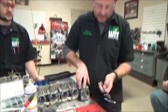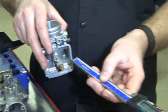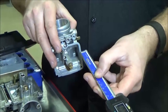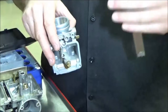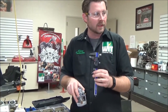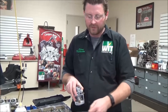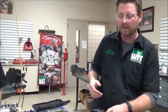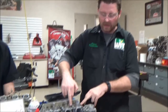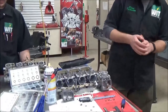So the trick is: let's say you're measuring a float height that's supposed to be at 12 millimeters. You subtract one millimeter for the thickness of the gasket. If the spec calls for 12 and you're leaving an old gasket in there that's a millimeter thick, you can't go all the way down — so you'd set the float height to 11. Here's a picture from the whiteboard drawing in class showing how the math is done with the float in place. I'd set it to 11. That's a way to leave old gaskets in place and put a bike back into service without adding cost, especially if the part is discontinued or not available. Measure it, subtract the difference — that's the tip.